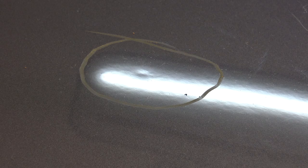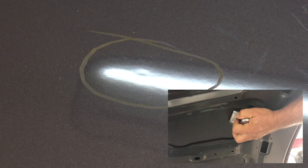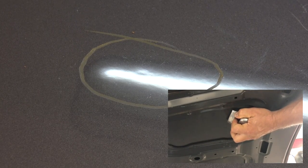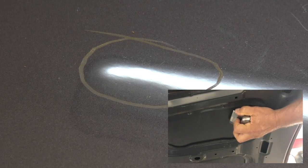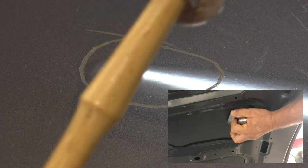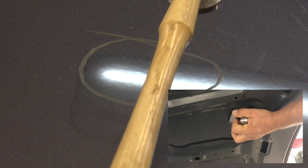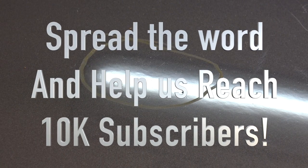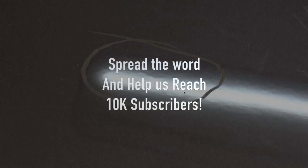We've got about a quarter-size dent here. We're dragging the dolly through right now to show you what that looks like, rolling the dolly, getting the center of that dolly right underneath the impact point — and we light the hammer on it. There you go. It doesn't take that long; with a little bit of practice you'll be able to do this very easily. This is one of the best beginning exercises for hammer and dolly work. If there's enough interest, we'll do more videos on it — don't forget to subscribe to the channel.